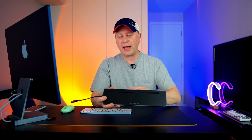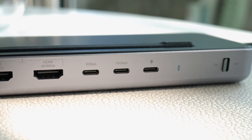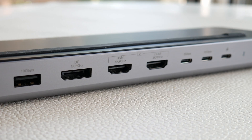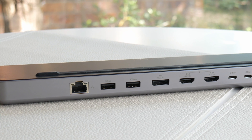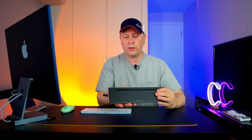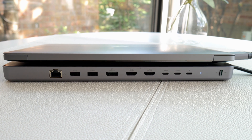So what are the ports? On the back it's got a whole bunch. There's power delivery at 75 watts — you can pass through power and charge your MacBook just fine. It's got two USB-C ports: one at 5 gigabits per second and one at 10 gigabits per second. It's got two HDMI ports at 4K60, one DisplayPort also at 4K60, two USB-A ports — one at 10 gigabits per second and one at 5 gigabits per second — and Ethernet at one gigabit per second. If you want to connect monitors, you can't use the USB-C ports for that; you have to use HDMI or DisplayPort, and you can connect two different monitors.